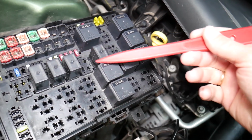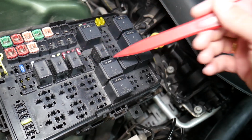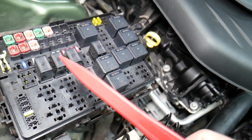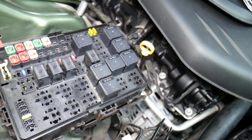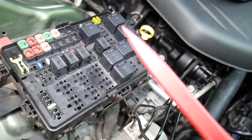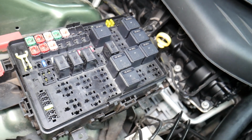The same thing goes for relays. Some of those could be really expensive on cars, so we'll put a link in the description of the video below on how you can test relays. And for certain fuses, it's important to disconnect the car battery when removing them, otherwise you can burn the electronics. For instance, when working on airbag fuses or anything like that, you need to wait at least 1 hour after disconnecting the car battery, and if you're not qualified and certified to work on the airbag system, I would never recommend doing that.